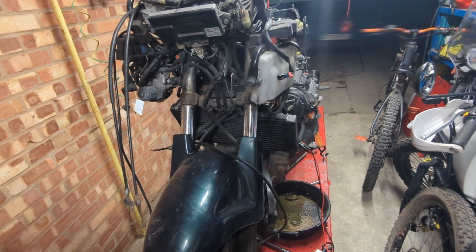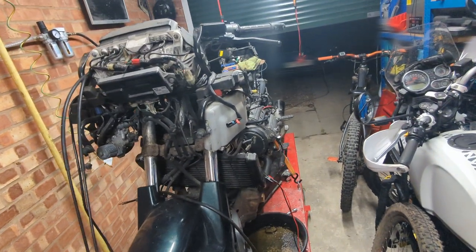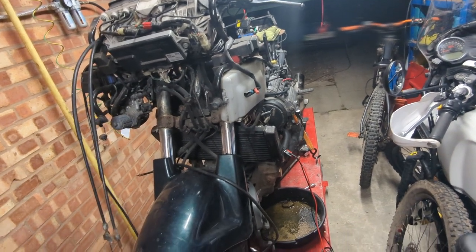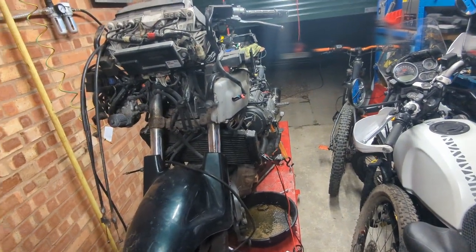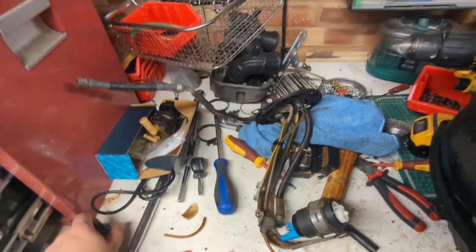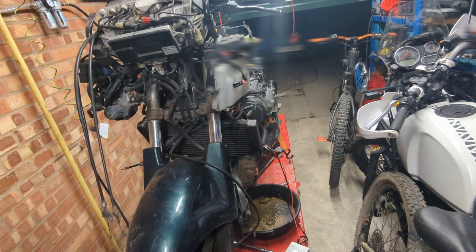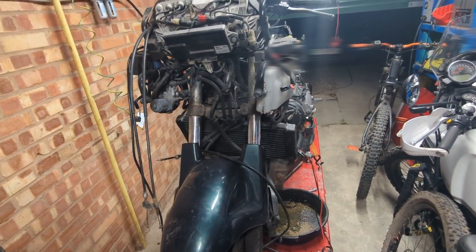As I think I mentioned earlier, I did manage to secure a new radiator, so we've got that to sort out. But before I put the fuel tank back in proper, I want to see if I can rearrange the bike on the lift. And we'll get that swing arm out and take a look at it, because I do have, freshly arrived, a tool to undo the strange nut that's on one side of the swing arm bolts. And yeah, we can use that to take the swing arm off and see if it's any good.